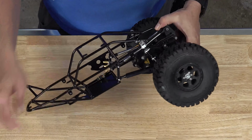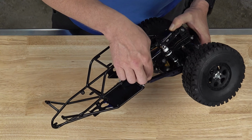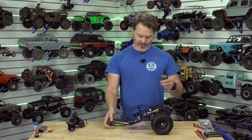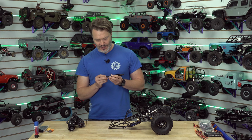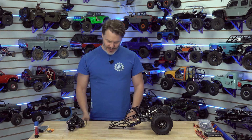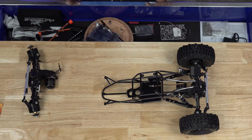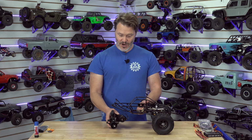So I had to use these style of trailing arms, which I need another pair of now, with normal rod ends. So there's a lot more clearance there, and it is not limiting our travel like these were. I may be able to, well, I really don't want to take a Dremel to them, but I could take a Dremel to these and clearance them out. But they're really only made in the Yeti, where there's up and down, and there really wasn't much side to side. So it's not exactly what the application needs or was for that part. So that's where I'm at right now.